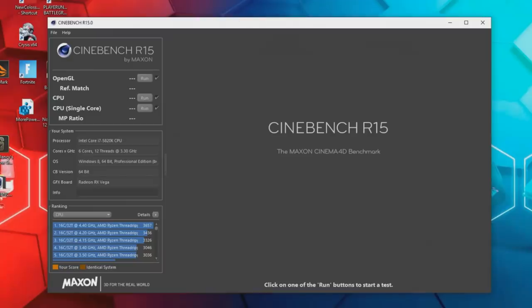So, let's just skip right to the goods, the whole reason why you're here, then you can get out of here. We'll run a little Cinebench and talk about it. So I actually hooked this up to my water cooling rig, with a 360 mil rad and a proper pump and everything hooked up in a custom, open loop style, and I can get this thing to 4.8 gigahertz, but even with this 280 mil rad, it's not happening.